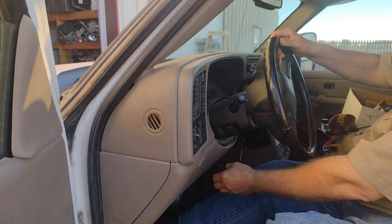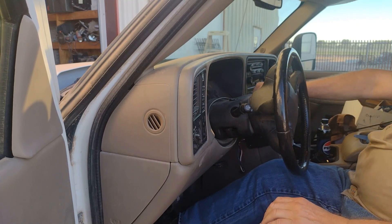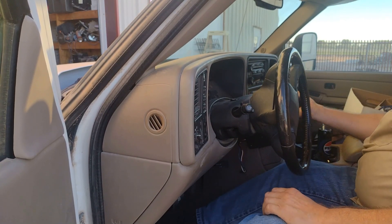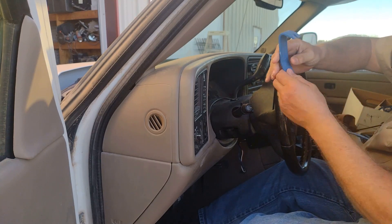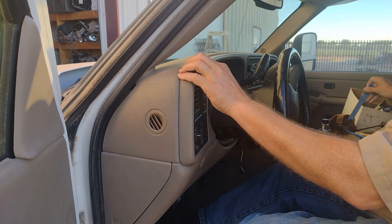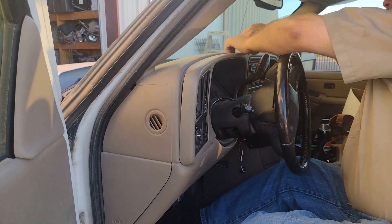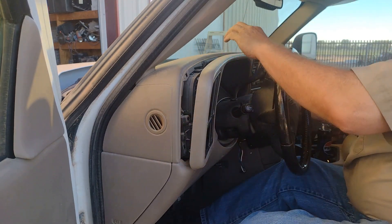What I've been told to do is tilt the steering wheel all the way down, shift it into manual — all that stuff gives you more room to work. Go ahead and set the parking brake. Then you just take plastic pry bars of some type and get in here and pop this off. I got these plastic pry bars from Harbor Freight and they were not expensive. Well, that popped out. This dash pan was just held in with spring clips, kind of like your wheel well protectors and other things like that.